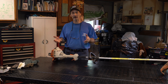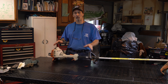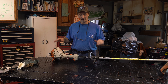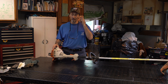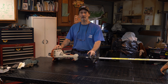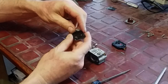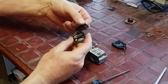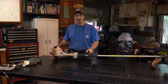I figured I'd reintroduce this machine. I don't know if I ever came out with a video on it. You can see she's still beat up - it was bent, thrown out, found at the dump. I think I gave Mikey 10 or 20 dollars for it. It was definitely abused, probably by a landscaper. I cleaned it up, replaced the diaphragm and carburetor, maybe even replaced the primer bulb - and that was a few years ago. It really runs well when it's running, very comfortable, well balanced, and reliable.